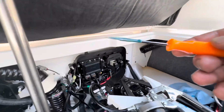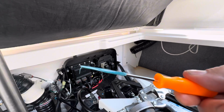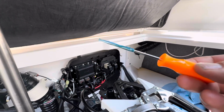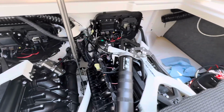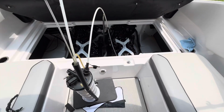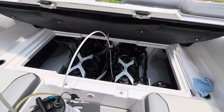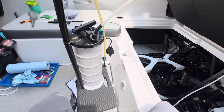All right. I mean, it looks good. Doesn't look milky, watery, oily. So I'm gonna reassemble it and put probably 2 to 5 pumps in there using this grease gun. And I'll consider the 100-hour intermediate shaft bearing greasing complete. All right, intermediate shaft bearings are greased, the 100-hour mark.